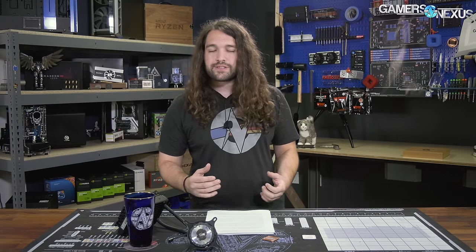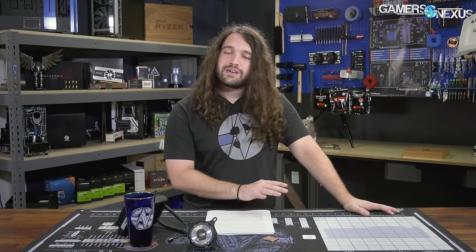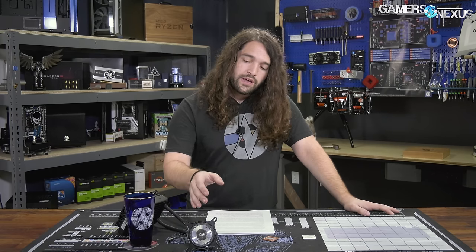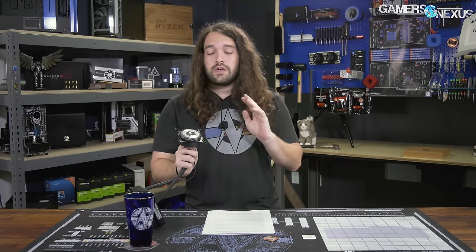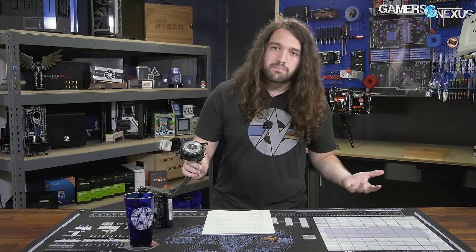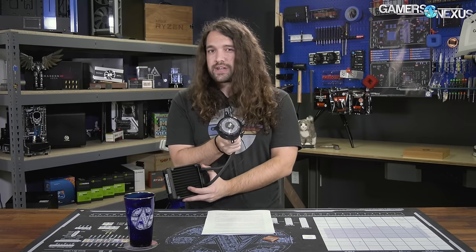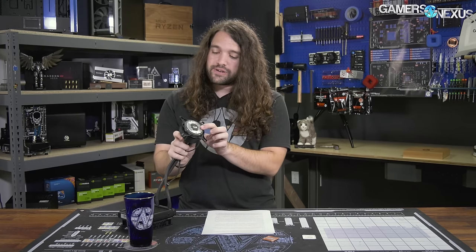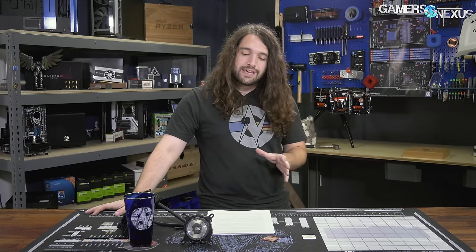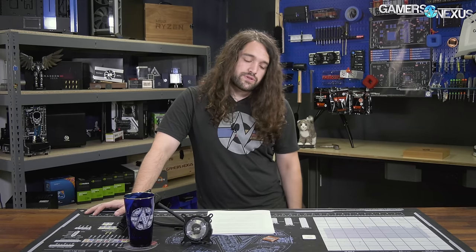In terms of answering what you can and can't use liquid metal with safely — keeping in mind that liquid metal is electrically conductive, so if you're not careful in something like a laptop, you could short something and damage it — strictly from a chemical standpoint, definitely never use it with aluminum. That's made abundantly clear in the packaging. We only worked with Conductanaut here, but they're all Galinstan compounds. Some have more gallium, some more indium, some might not have tin. Depending on what you're working with, how extreme the reaction is will change, but with any liquid metal compound, just don't use it with aluminum.